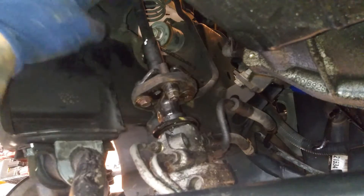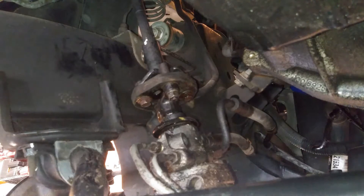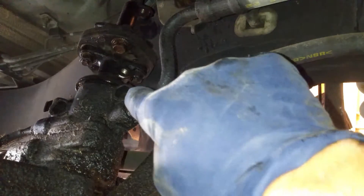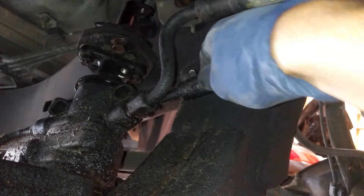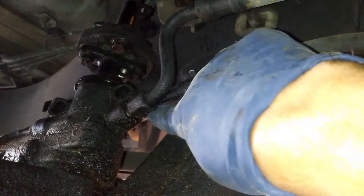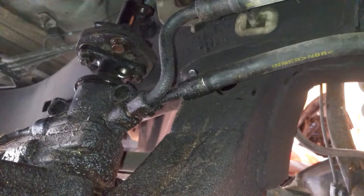We'll let all of this drop because the top part goes up and down but the bottom's stuck on there — I'll take that off while it's off the vehicle, and then we can center the bottom later. Now we're going to go ahead and disconnect the hose lines. This one's going to be a 17mm. Then we're going to take off this little hose clamp right here, and then go ahead and take off this bolt or the fitting — we'll take that off later, no need to remove it right now.